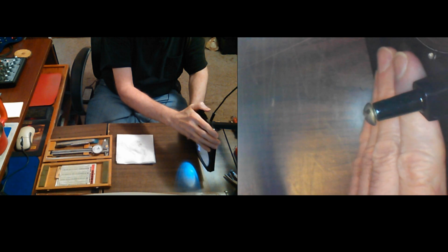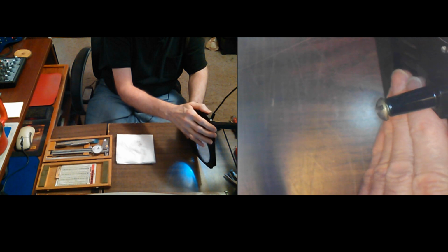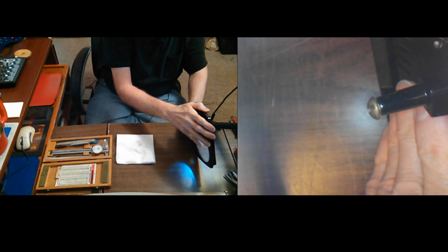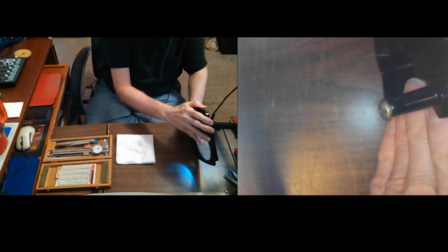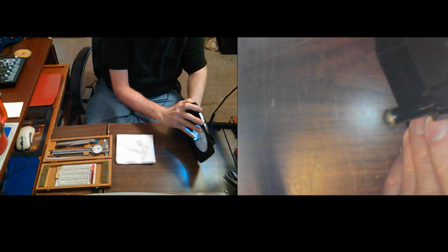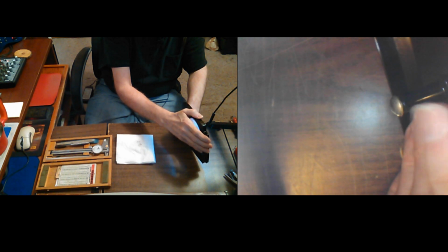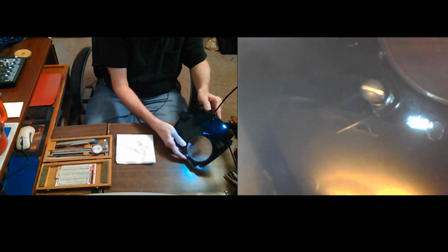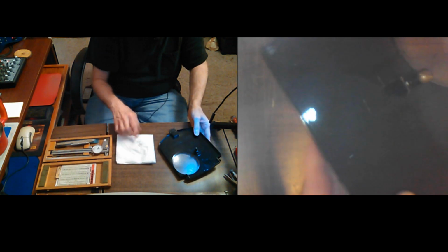So, yeah. You got one that's that close. The main thing is if you got some calipers, if the inside of that screw shaft, the smallest part of the whole thing, is smaller or around the same as your hole, then with plastic, if you heat it up, the plastic will get out of the way when you heat up the screws. I've done it before. This little thing, if I'd heated that up, I'd have had it looking like a pretzel in no time. So heating up the screw was better for me. Now, if it's just not too much, it'll be really good.